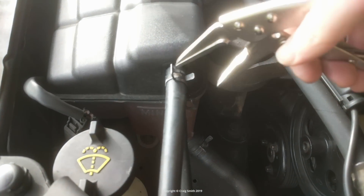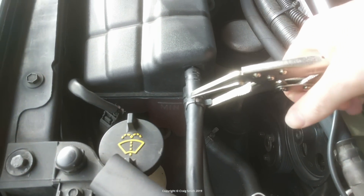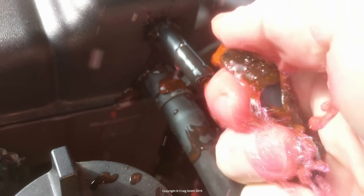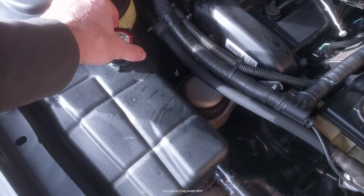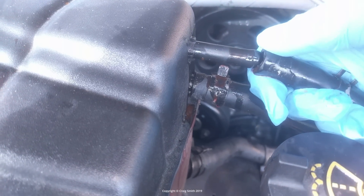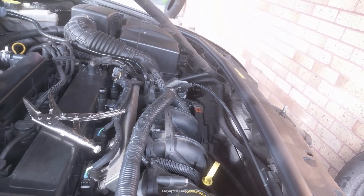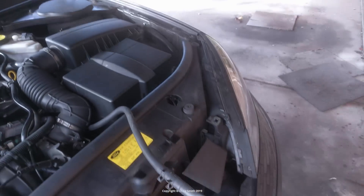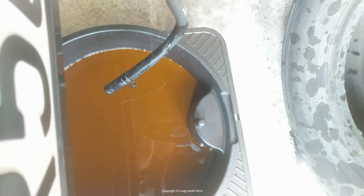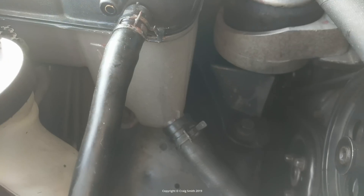As with the second video I did, which I labelled Redux, I'm going to get in here without fully draining the system, which you can do by pulling off this top hose. But don't be stupid like me and do it when you just drove the car, because this will happen. Let the pressure out first by taking the expansion tank cap off, and let the whole system cool down as well. So take two — that hose can extend down to a clean container and you can save a bunch of fluid. I'm doing this because this coolant is still relatively new and there's no need to replace it, and it's expensive, so I'm going to reuse it. You can drain the tank and some way down the hoses; I also used a pump to get a bit more out. You'll still make a bit of a mess when you take the stat off, but you don't lose too much coolant if you do this.